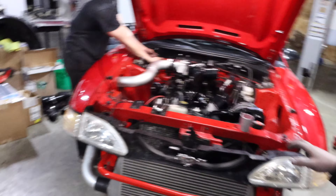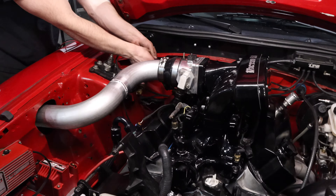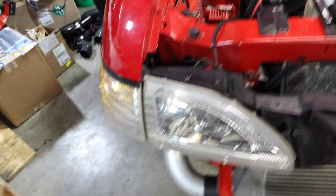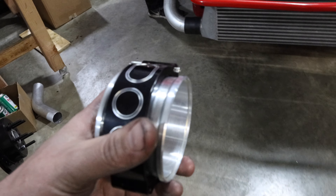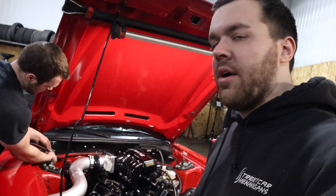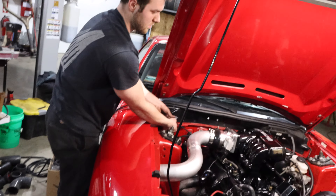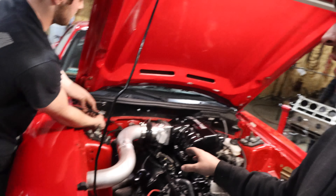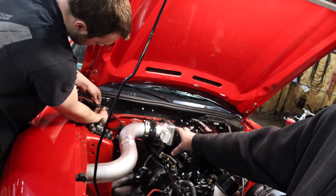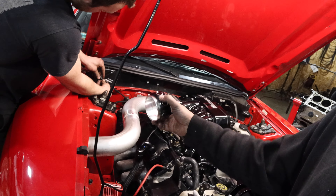We're going to hide a couple more of these wires in the fender well — this area is going to look good with the powder-coated black alternator. We're getting ready to put the intake manifold on. We get the lower on, injectors and rails in first, then drop that on there, and she should be ready to assemble. Fast forward 15 minutes — we are making progress. This is starting to look incredible in here. Dan and I have a bet — five dollars — I think it might have an interference problem with the distributor, but we'll see.